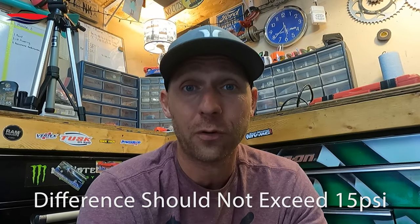For my boat, the engine is doing great. I tested while it was cold — if you test warm you'll probably get a slightly higher reading. The point is you want to test cold because that's how the engine starts. You need around 150 PSI minimum for the engine to fire. If you did this test and have low compression, the most common cause is carbon buildup on the exhaust valve not sealing properly — that's typically where it starts. The intake valves are usually clean because as the injector fires, the gasoline acts like a solvent and washes carbon off the intake valve. Exhaust valve buildup is where the issue typically lives, and the valve seat getting damaged causes problems too.